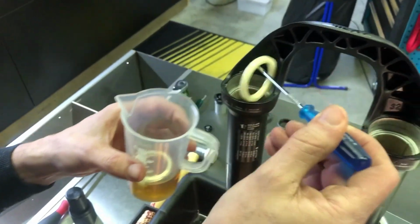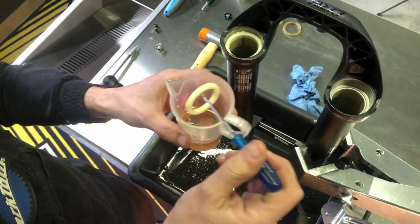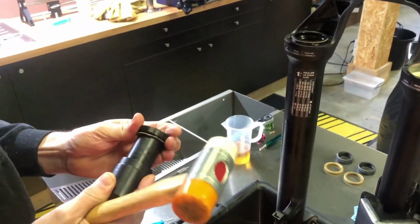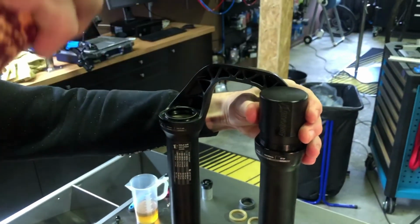With the legs clean, place the new foam rings into the lower legs. Use a pick to get them out of the plastic container. Since the foam rings were lubricated when moved into place, we don't need any extra lubrication for the seals. The foam rings have left enough on the insides of the lower leg.